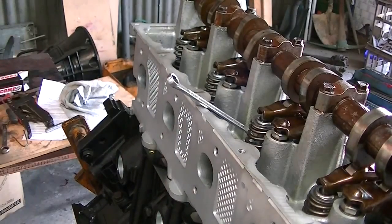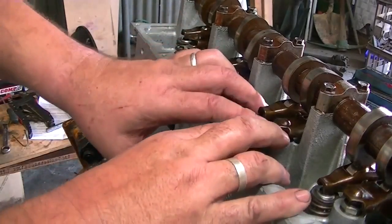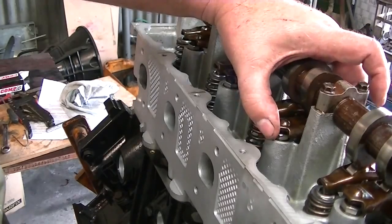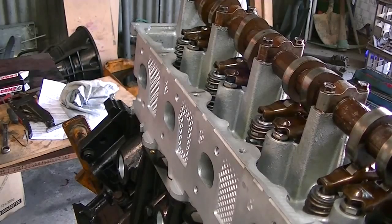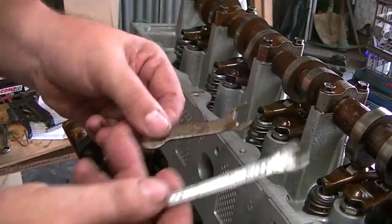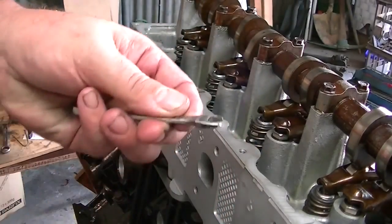Here is how I worked out my way to adjust solid valve lash adjusters in my 4.7 Jeep engine. I found it very difficult to get spanners in here, especially on the inside, so I made some spanners. That one started to buckle but I'm still using this one — I've ground it down and made it smaller so it's easier to access.